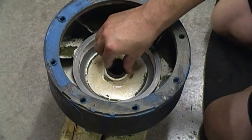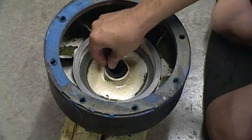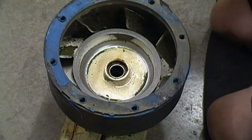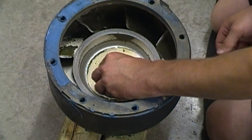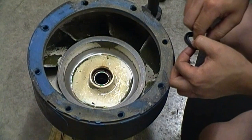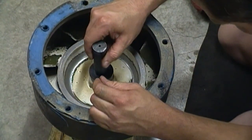Here's the seal I took out of here — you can see it has a snug fit. Here's the seal that came with the kit, and it's actually a really loose fit — so loose that it would just come right out. So I went ahead and got a slightly larger seal, and I'm going to drive it in just until it's flush so I don't block those oil passages. I have a thin layer of Permatex on the outside perimeter, and we'll see if we can get that to seal.